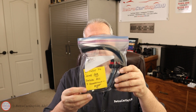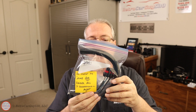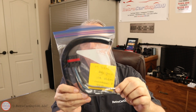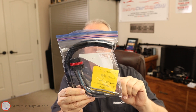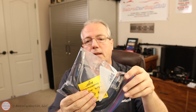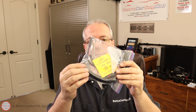There is a replacement part from simple-engineering.com. Mike has a product called the SSR Main Fan Harness Repair Kit, and it includes the parts necessary: the new connector, the pigtail wires coming out, uninsulated connectors to crimp and then solder, heat shrink wrap to go over the uninsulated crimp connectors, and the outer shell to go around the whole thing. The wires are staggered to make sure you don't have one bulky connection at one point, making it easy to put into the protective covering.